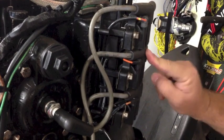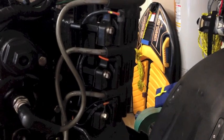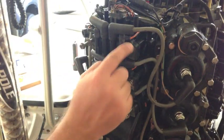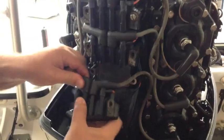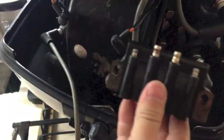This spark plug wire comes right off here, and this is the cable that comes off the power pack. The first thing we're going to remove is these six bolts to get the coils off to access the power pack. We'll leave the top bolt in so the whole assembly doesn't fall. The only thing you have to watch for is there's a ground wire on this bottom bolt — we want to make sure we install that right where it came from. These just pop right off, just as easy as they come off spark plugs. I'm going to put these in the same order they came off, just to be sure.